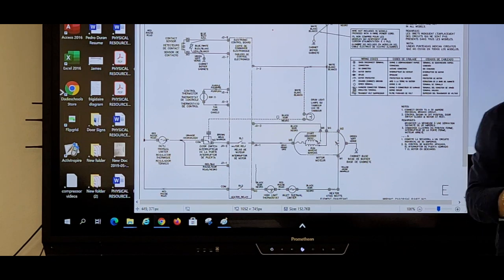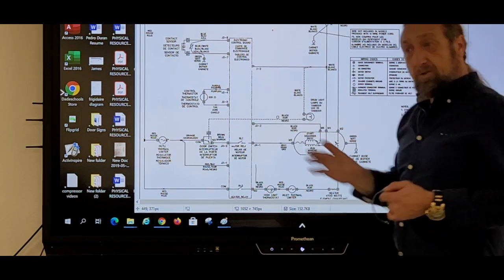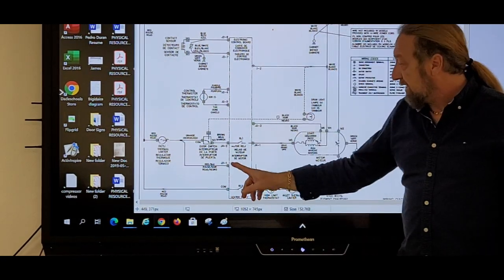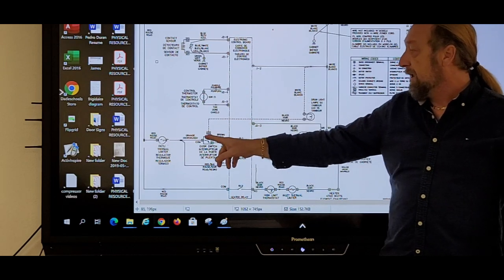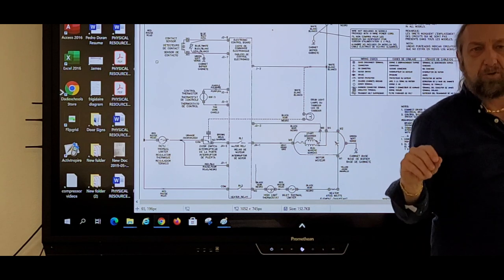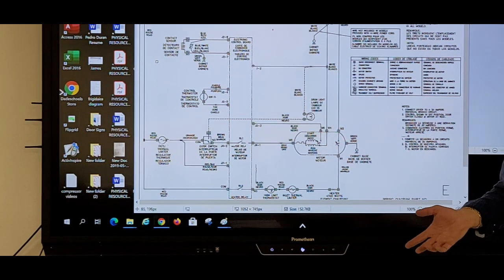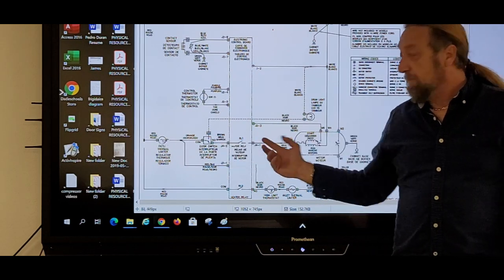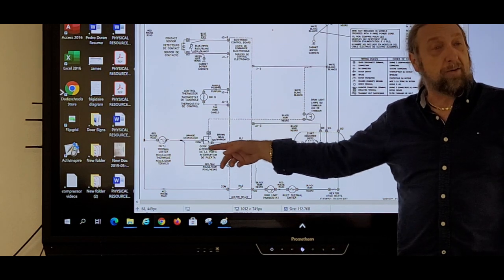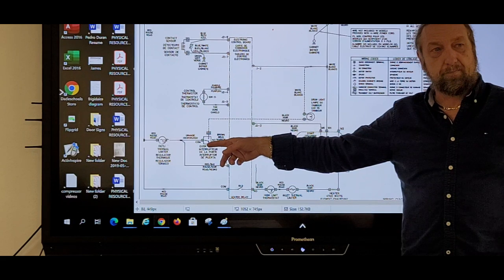Yeah. Now the door switch, how would I use the jumper wire on the door switch? Let's say I go to the customer's house, and I checked here and here, and I got power, the board lights up, and then I checked here and here, and I didn't have power. So I said, you know, the problem is my door switch. Go back. How would I do it? Door switch to it. If I jump out this relay, if that door switch is bad, it don't matter. I'm not going to get power coming in here. Oh, you got to press start? So you got two problems. You got a relay bad and a door switch?